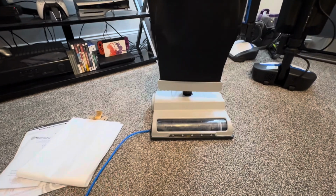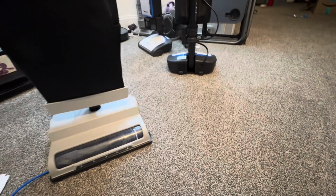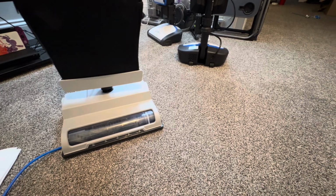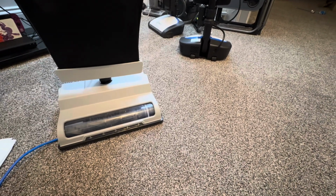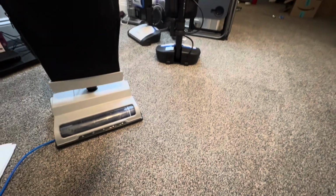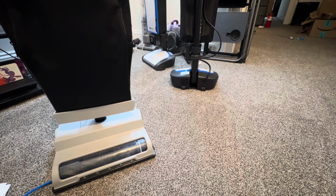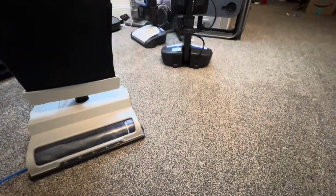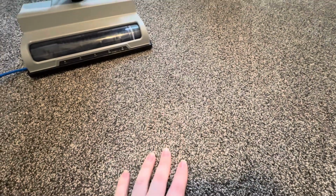Again, durability is not going to be all that great, but this carpet, for an example, a regular Oreck XL or XL21 will not work on this machine. I have an XL21 based Axis, and it burned through its belt almost immediately because you cannot push it on this carpet. These One Power Hoovers, these are XL21 based, but the lower motor speed and lower air volume that they produce, as well as the softer brush roll they put in the cordless machines, will allow them to be used on this. But a normal XL or XL21, no way. You pretty much have to use a magnesium if you're doing Oreck on these carpets.